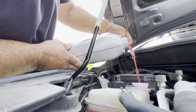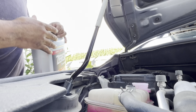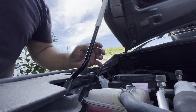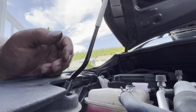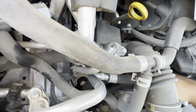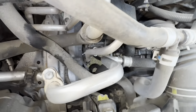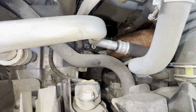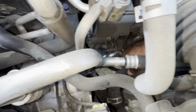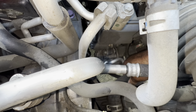I kind of spilled it a little bit, but you're just going to slowly add it. I'll probably run the car a little bit and then keep adding more. I'd recommend a funnel but I don't have an extra one. I also squeeze this tube on the radiator right back down here just to bring out the air bubbles — you'll see it, it's pretty obvious. I squeeze that to get the air bubbles out; it does seem to help.